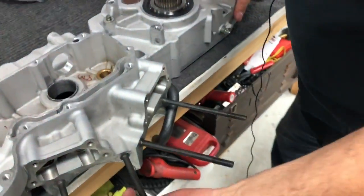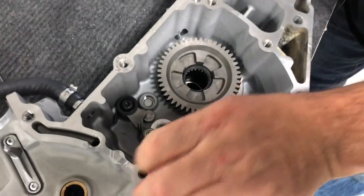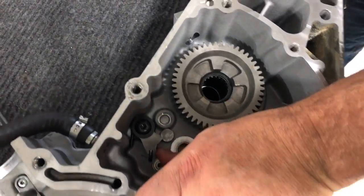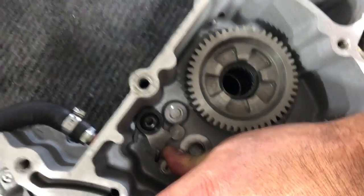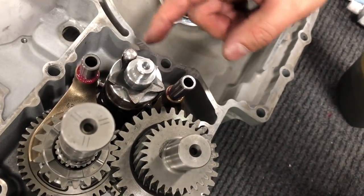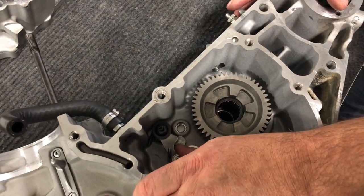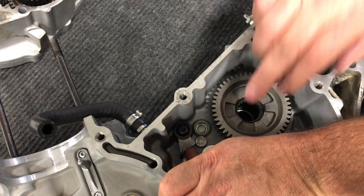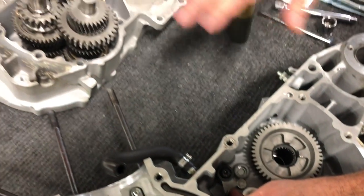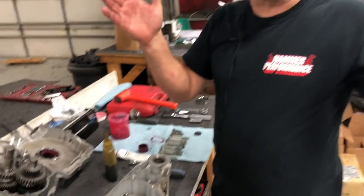Now what this does, it holds back your neutral indicator arm that rides on the shifter drum. On the outer part of the shifter drum here, it rides through the gears. This wheel rides on the notches, and when it gets to neutral, it trips the neutral indicator switch. But we have to move this back out of the way so that when we put the case halves together and release it, it falls down. Otherwise, you're going to crimp your two case halves together, and it's going to bend this arm,